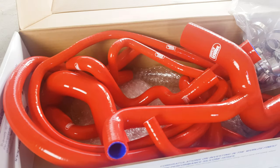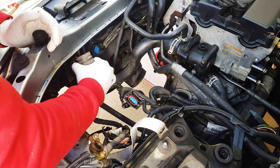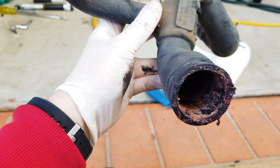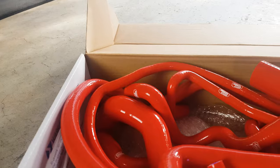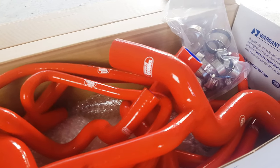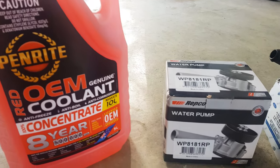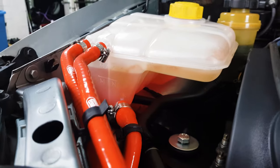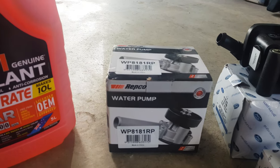With the hoses I've decided to replace them all because I know that some of them were close to failing, and usually if one hose fails and your other hoses are the same age, you can bet those other hoses are not far behind. Since I decided to do all of this, I may as well upgrade to a silicone hose set. You can use rubber hoses if you prefer, or if you'd like a silicone set like this one, I'll leave a link in the description. I went with red hoses because the coolant this car takes is red in colour, so I can always spot my coolant system hoses straight away.